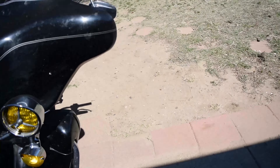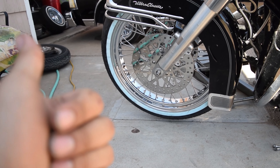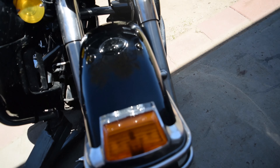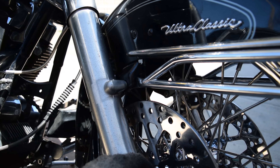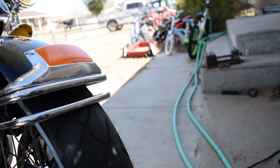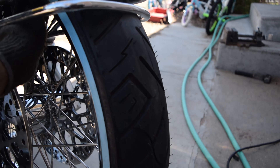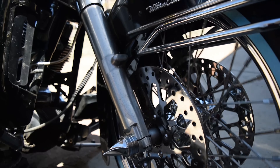We should have it knocked out when I bring you guys back. Axle nut is tightened up, pinch bolts tightened up, Loctite on the fender, little washers on it. Here are our clearances — as you can hear it's just hitting the little tire hairs with no resistance whatsoever. Probably after the first ride once the middle section wears down, the hairs should be golden. That's basically it — that's how you install a 21-inch wheel on the touring bike.